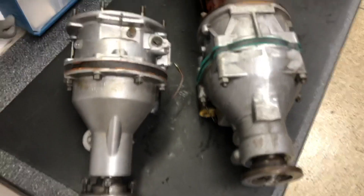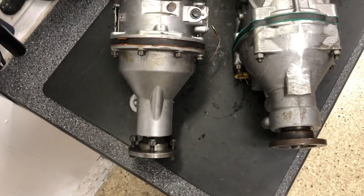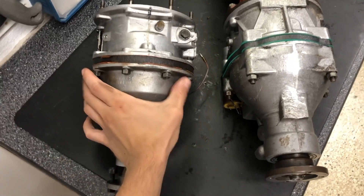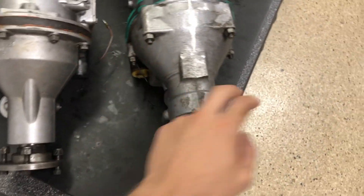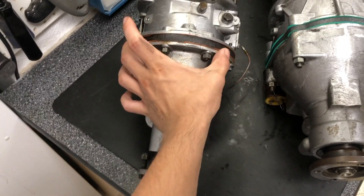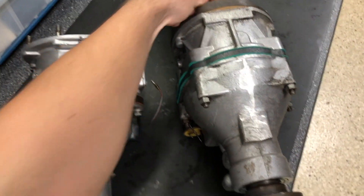Another obvious thing is the J-type has a smaller casing size altogether and is a little bit more of a perfect circle than the D-type. The D-type has bumps out here for the four to six major mounting bolts. The J-type uses a ring of small bolts here as well as here, while the D-type has that ring of small bolts only in the front.